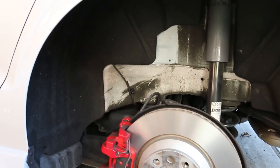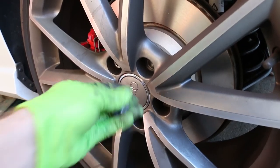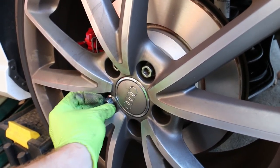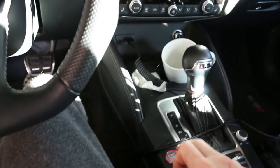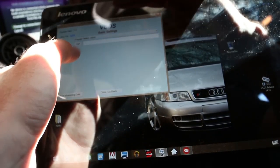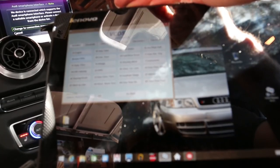New pads are installed - looks good, red on red, I like it. So the wheels are going back on. I want to talk about wheel bolts - I don't know why everyone complains about them. If you have hub-centric wheels it's not that hard. Yes, lug nuts or studs are definitely easier, but it's really not that hard. Rear pads are installed. We're going to put the car back into accessory mode - hit the start button one time without my foot on the brake. Then go to ABS brakes and into lining change mode.